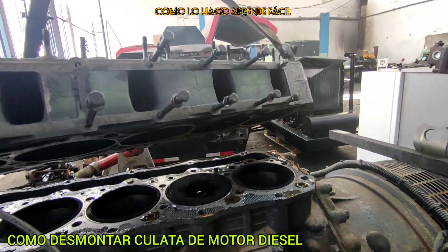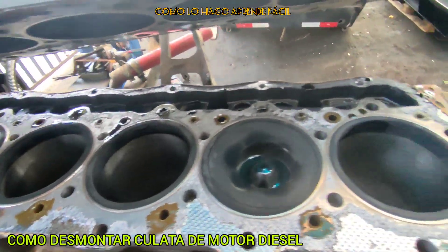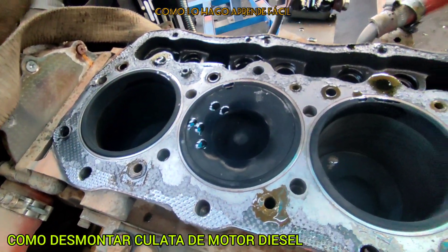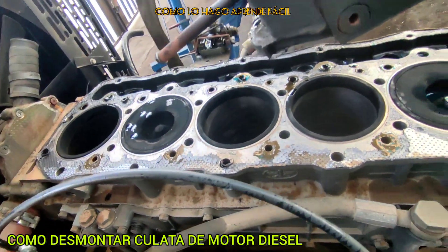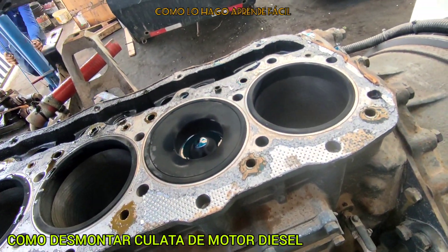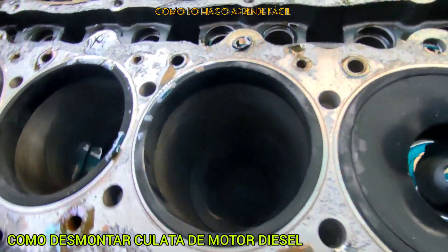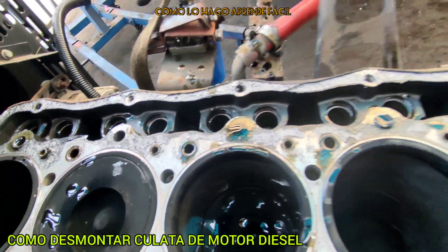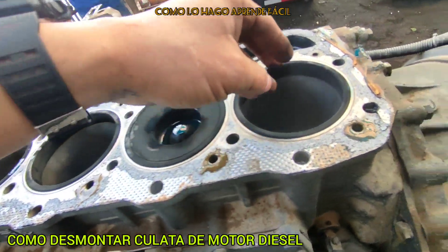What we see are just oil drops — part of the lubrication that was up here. Here we can see the combustion chamber alongside the pistons. We have the bore right there and part of the gasket that has come off. There is no visible scratching. The equipment is practically new — it has only 17 hours. The honing is very good and there is no play in the pistons. The only problem has been the culata gasket that has failed.